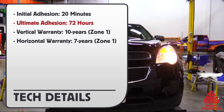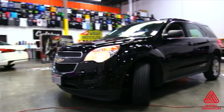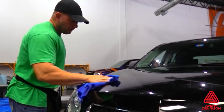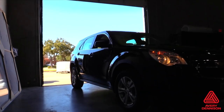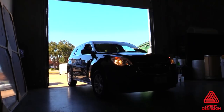In order to ensure a professional product with long-term durability, it's important to finish off an SPF-XI installation properly. This can mean letting the install sit for a few hours, then coming back to wipe it down. Be sure that all edges are sealed and that there are no bubbles. Also, wipe down the face of the install to remove any residue left behind by the glide solution. Avoid using harsh cleaners that have solvents. If the outside air temperature will be above 50 degrees Fahrenheit, the finished install can be returned to the customer that day. If it will be below 50 degrees Fahrenheit, it's recommended to leave the install inside overnight to allow the adhesive to build up properly.